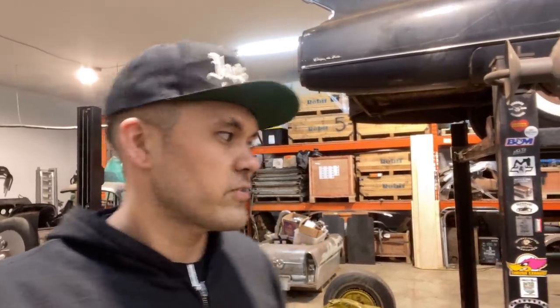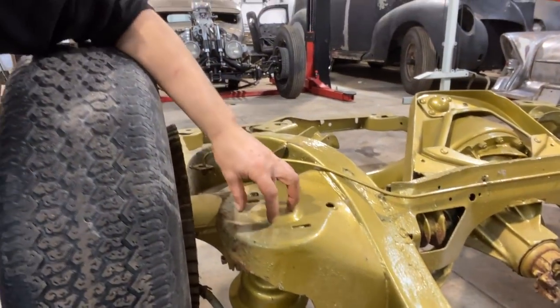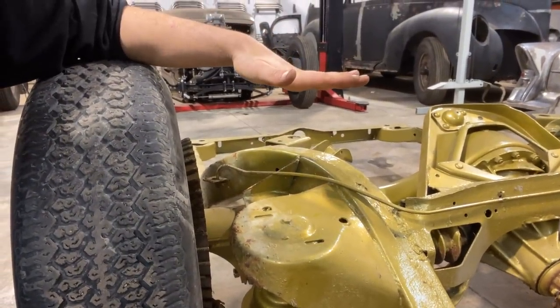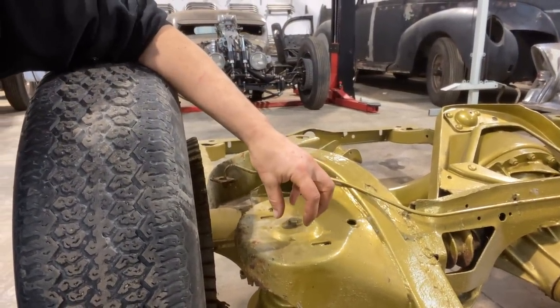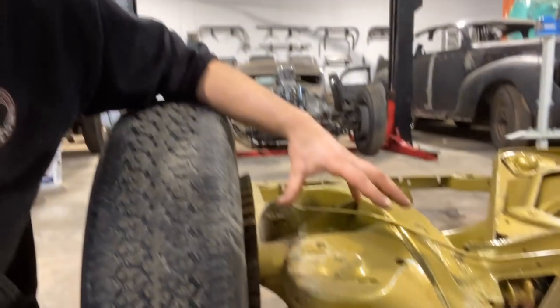And you may have seen in the comments, or maybe you commented yourself, why aren't you doing coil over? That's like the best way to do these cars. Absolutely right. So the sweet thing about coil over is that now our cylinder doesn't stick up super high in the pocket of the spring. So instead of the cylinder sticking up through here to about there, it's gonna only stick up a little bit, but it will move with the suspension up and down. This may not make sense if you're new to this kind of suspension, but I promise it will get simpler as you see it come together.